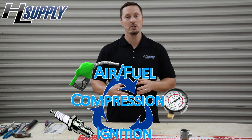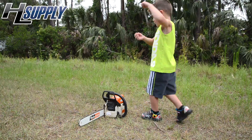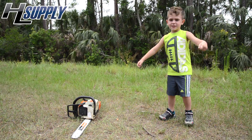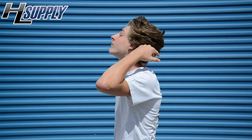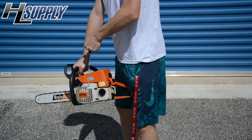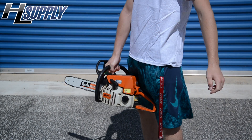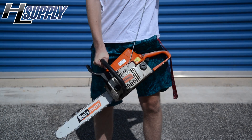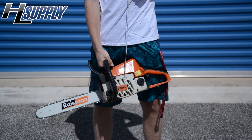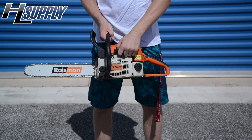We're going to look at that to diagnose what could be wrong with the saw. When your machine's not running properly, one of the first things you want to check is a compression test. Start by pulling the starter rope slowly. Feel for the compression stroke — does it feel strong, is there resistance, or little to none at all? If it pulls through easily, the engine may not run or perform. If the rope will not pull out at all, then you know the engine is locked up.